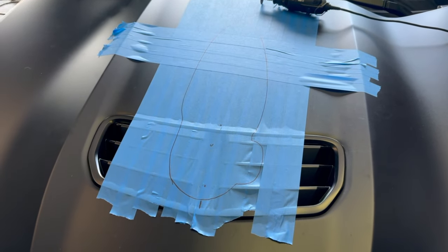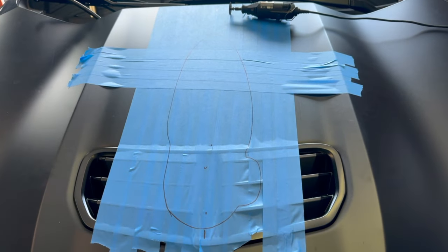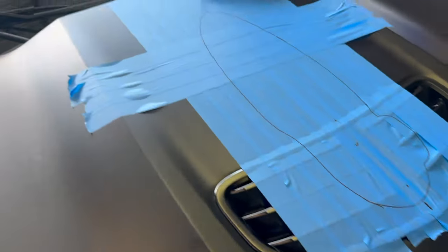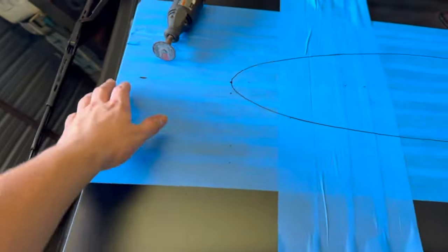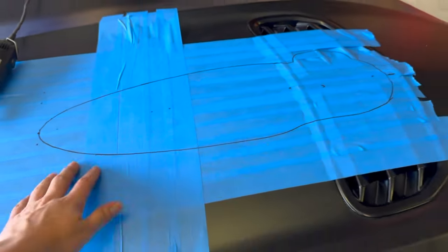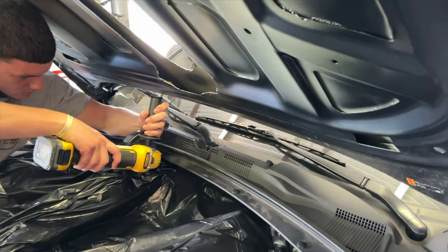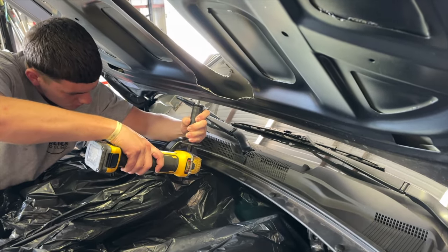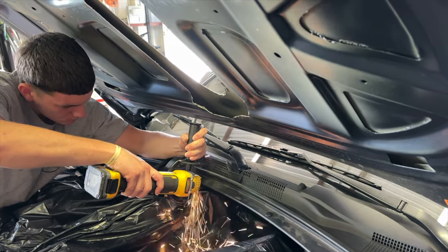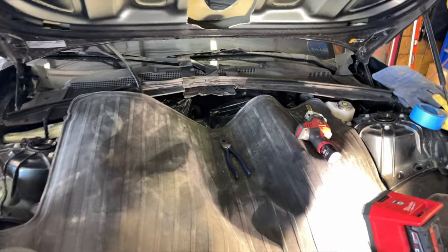Got all that disconnected — all the PCV lines, intake manifold, throttle body, the intake. The intake has two rubber grommets down here you have to pull off. Disconnect the MAP sensor and the brake booster — just disconnect it from there and pull it off with the manifold while it's still connected to the back. If you have the DSX flex fuel kit, you have to disconnect this side of it off that little nipple; you can keep it connected on the other side.